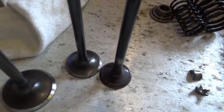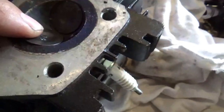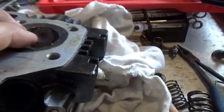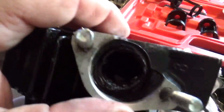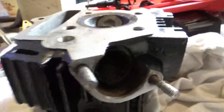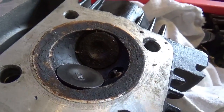Well, that ain't good, is it? I put the new valve in and it seems like when this one opens it's going to miss — not by much, but it looks like it's going to miss. And it looks like it's below the surface. One other test: I pushed it all the way in to see if I can shine a flashlight around it and I don't see anything. So I think I'm going to lap it and we're going to put this together. Keep your fingers crossed — maybe it's going to work, maybe it's not.